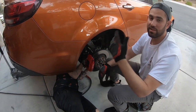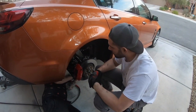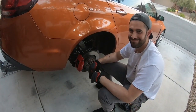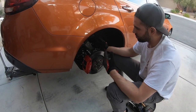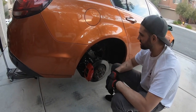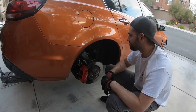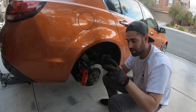Weather is turning to crap as per usual — basically every time Ricky shows up the weather goes south. We're gonna disconnect the upper mag ride harness, pull out this side, compress it, pull it off, and put it back together. Honestly the hardest part is the wiring. Everything else is pretty simple if you have a spring compressor.